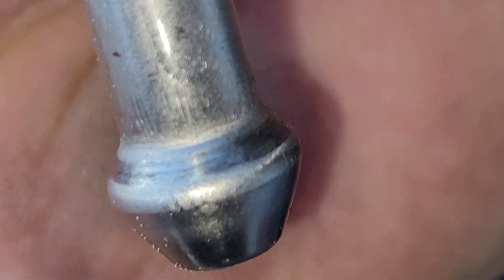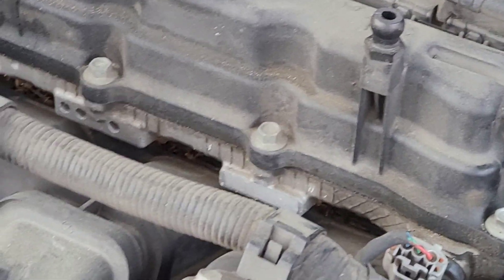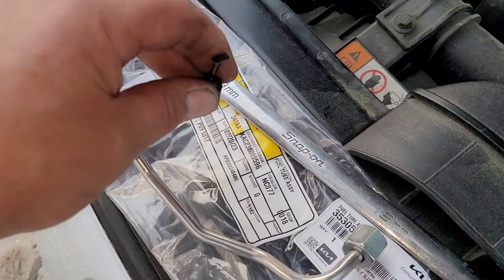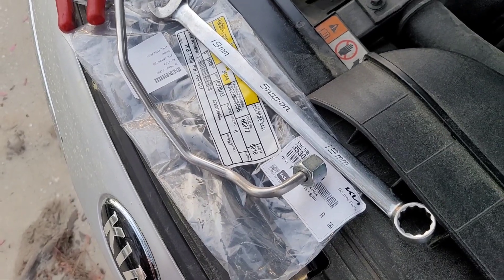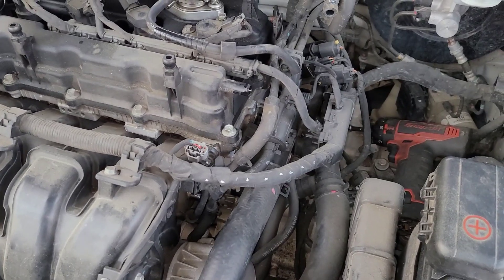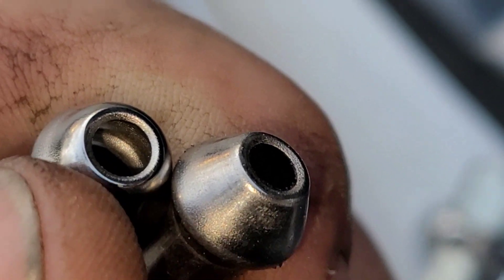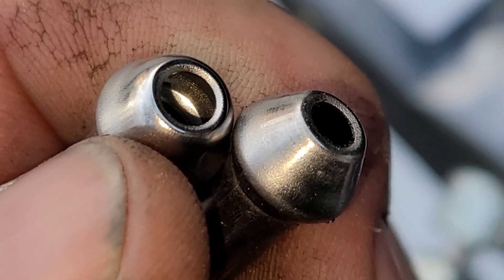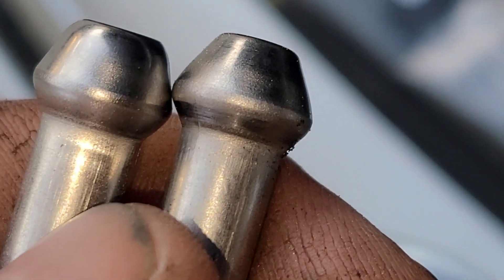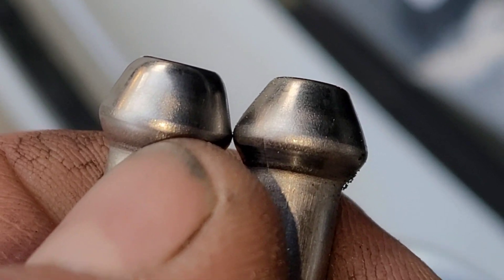What I'm going to do is lay this back in place. I'm also going to put this back in here to hold the nut end on the line while I feed it into place, because otherwise the nut end is going to flop all over and cause a real headache. Now, before I install it — this is the new line, that's the old line. Look how much smaller the end is on the old line compared to the new line, because the new line has to crush into place. I need to verify what the torque is supposed to be on those nuts because they were actually bottomed out and I don't think they're supposed to be bottomed out. You can see a definite difference in the taper — this one has a sharper taper than the old one because that soft taper is what gives it its seal. It has to basically crush into the female end to seal in place.